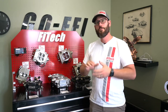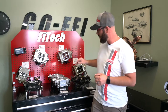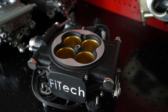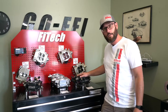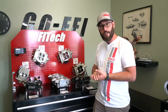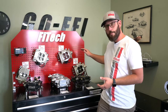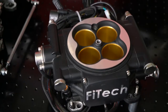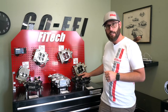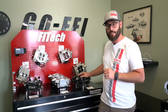Now let's say you want to do some power adder setups for your 383 stroker. Right here is our 1200 horsepower PowerAdder GO EFI 8 EFI system. We also have a 600 horsepower version. Let's say your 383 is making 500-ish horsepower and you're not running your supercharger or boost currently, but you plan on it in the future. If that's the case, buy your power adder system, run it naturally aspirated, and when you get that supercharger installed — if you're doing blow-through — just put the blower hat on and let the system tune right over your existing tune.